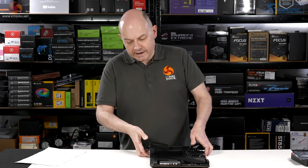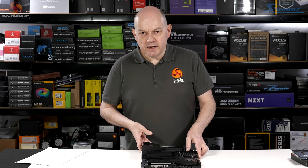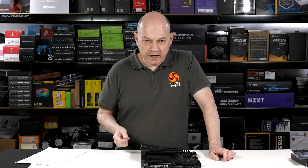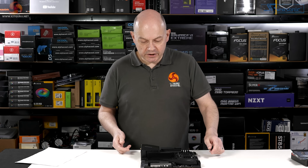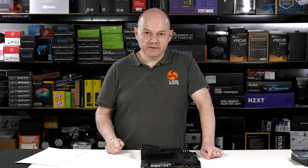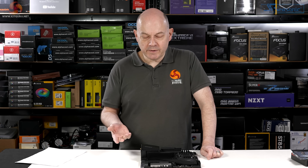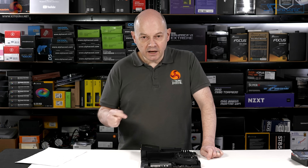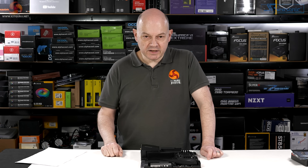When I mentioned I had doubts about a DisplayPort on the rear I/O — generally speaking, I prefer DisplayPort to HDMI. The thing is, I don't think anybody is going to be using this board with the IGP. The only function for that connector is fault-finding: if your graphics card has a problem, you plug directly into the processor and use the IGP. Though clearly it doesn't apply to the F-SKU processors.